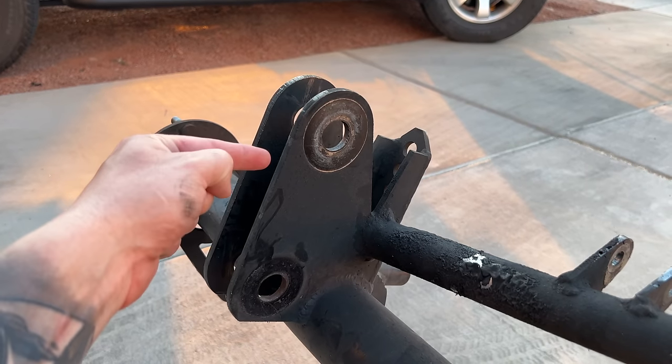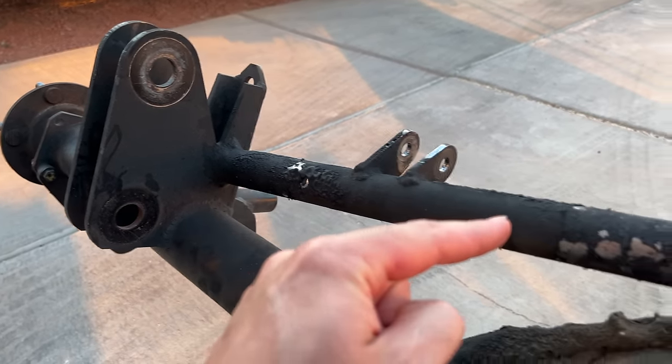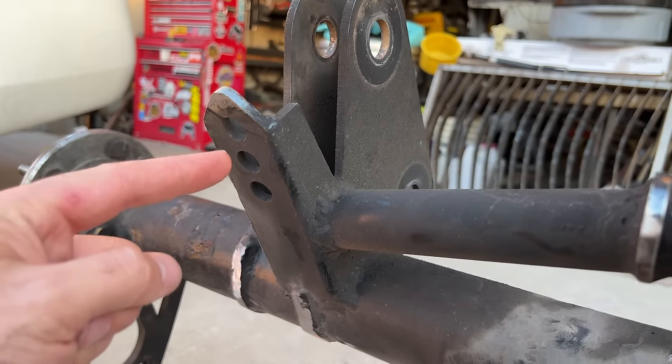I've got Keith's axle back at my garage and I need to cut off the original link bar tabs to make room for my link bar tabs. So here's the current setup. These have to go, but he's got this support bar / shock mount bar welded across both sets of the existing tabs. Also on those tabs are these things.